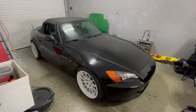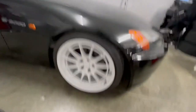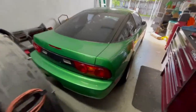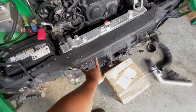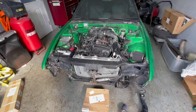It's more of a track stance look. The thing I didn't like about the 215s is that at higher speeds I felt a slight wobble — like the car was kind of all over the place. It wasn't planted like how the 255s and 245s are. This setup feels way better. I also painted the wheels — they're nice and white now. I still need to grind off the welds where Pablo welded the new radiator support, give it a quick spray there, mount the intercooler, bleed the system, and it should be good to go.